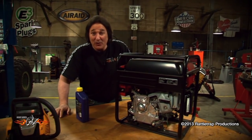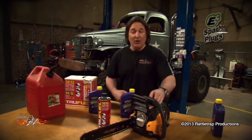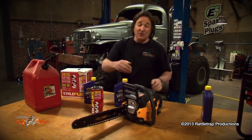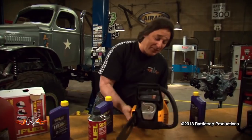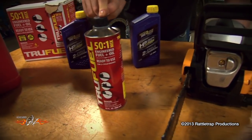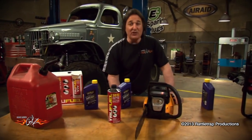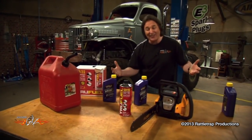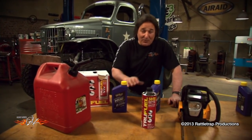Synthetic oil will last longer and lubricate better than conventional oil until you get around to changing it. Most people realize that two-cycle engine oil is completely different than four-cycle — it gets its lubrication from mixing gas and oil together. So it's important that you know the mixing ratio for your tool, usually written on it in a couple of places. For example, this saw is 40 to 1. But if you buy pre-mixed fuel, notice that is 50 to 1. Use that fuel in that saw and you're going to burn the saw up. If you can't get pre-mixed in your ratio, pick up some two-cycle oil, mix it with gasoline to the proper ratio, and you'll be good to go. This is one of the main reasons most two-cycle engines are burned up — somebody put in a bad fuel mix.